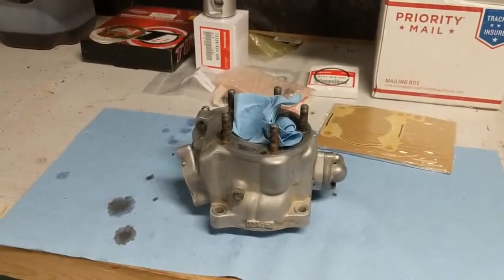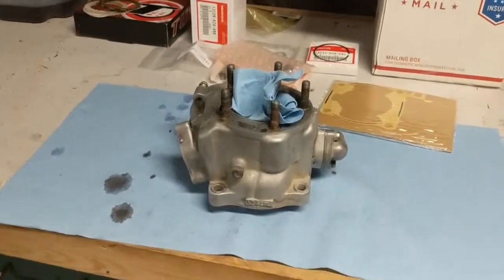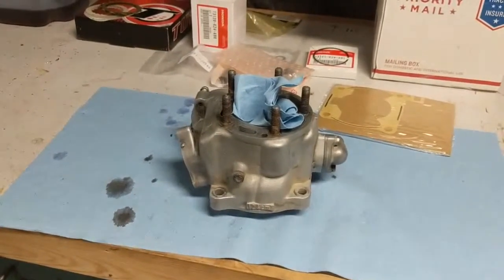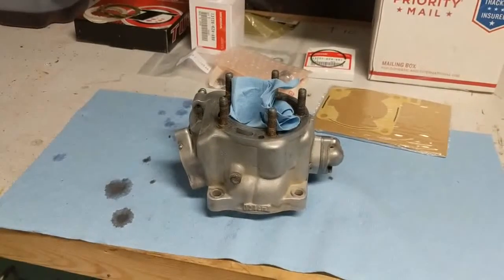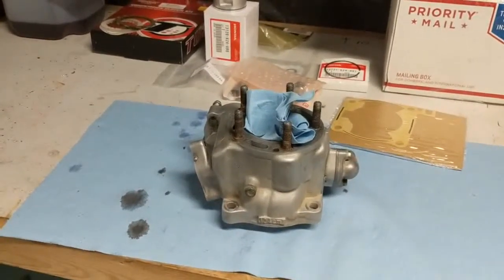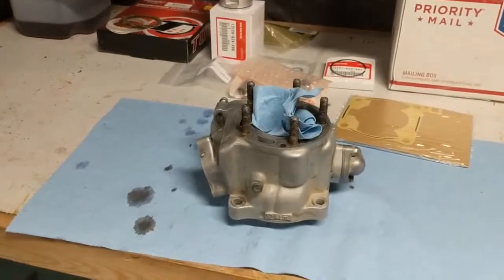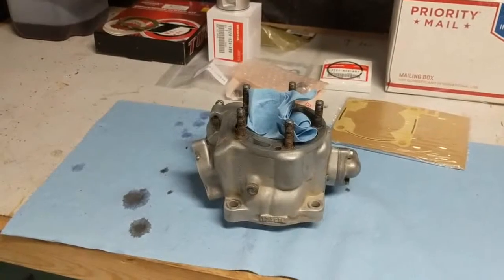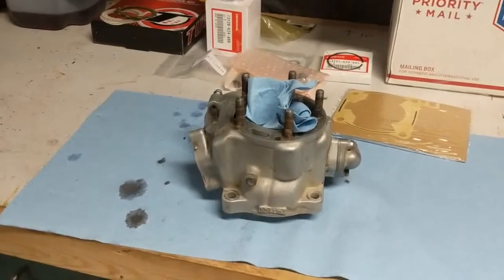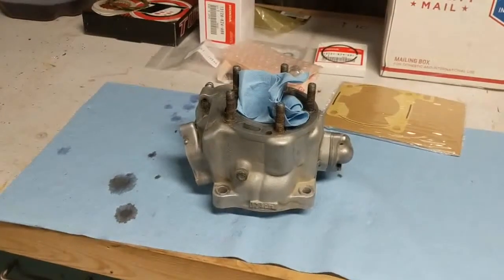But this one here, I'm 98% certain it's steel. It's a 2000 CR125. If anybody watching this knows more about it, comment below, please. But like I said, I'm certain it's steel. I stuck a magnet to it. That doesn't prove it 100%, because even with the nickel coating, if you have a strong enough magnet, it would probably still stick. But I used a real chintzy magnet, like a refrigerator magnet, and it stuck good. I've been working on this kind of stuff for a long time, and it looks like steel, feels like steel, and the magnet stuck to it, so I'm comfortable saying it's steel.